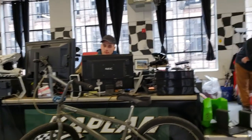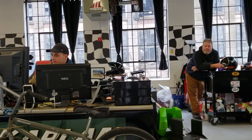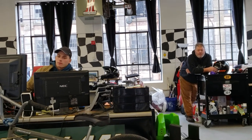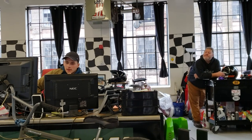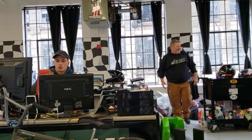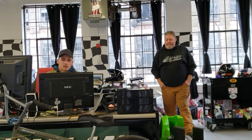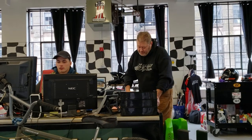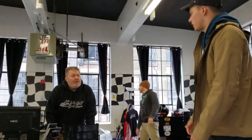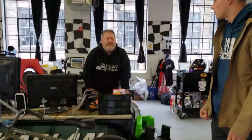So, Junior, you and Jimmy Laurinaitis over here, we were talking yesterday about building a drag bike. What was the spec? You guys spent about a half an hour debating. Right. Jimmy has a mentality that bigger is better. And we had a 45-minute conversation just on building late 70s and early 80s Kawasaki motors. And we were going to do one with the cases off the 900. But Jimmy was saying you get phenomenal results with even just a small bore increase, like from the 900 up to like a 1075. 1075 kits are really good.